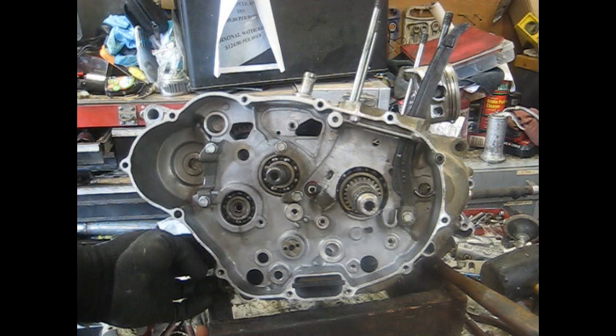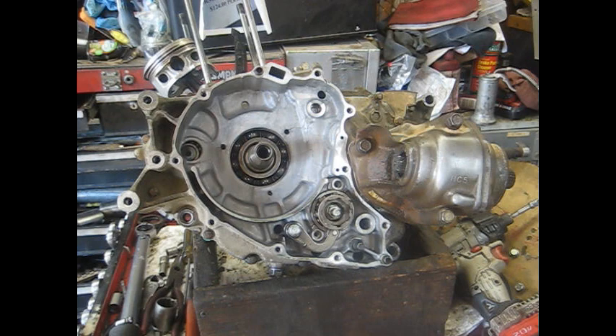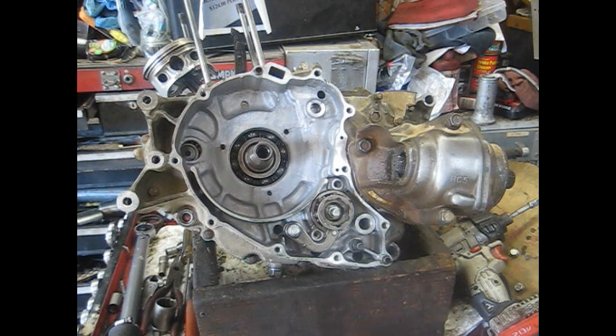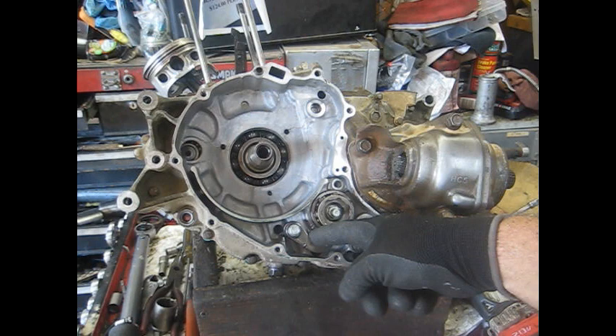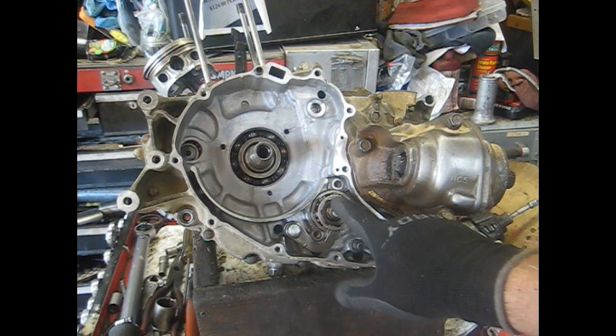About seated all the way on there. I'm going to get a few of the bolts — this side only has that one bolt so I'll start it in there, not running in real tight, then flip over to the other side and run all those bolts in. There was a slight distraction in the shop so I didn't turn the camera on to tighten this bolt up. What happened is I pried this arm down with a screwdriver. There's a 12-millimeter bolt, and there's actually a little alignment pin on that shift shaft that you have to line up with the notch on the back of the star piece. I got that tightened up — I think it's about 25 Newton-meters but I just tightened it down tight.